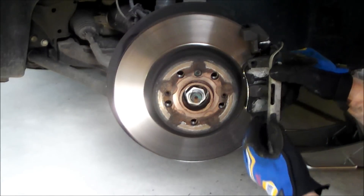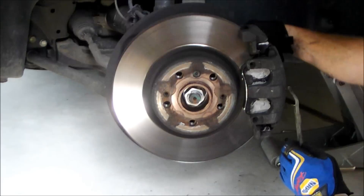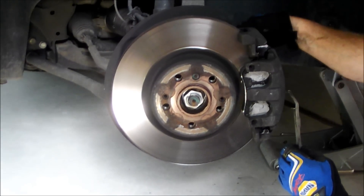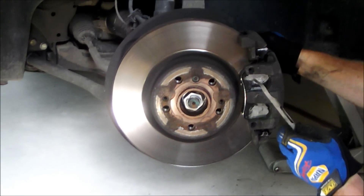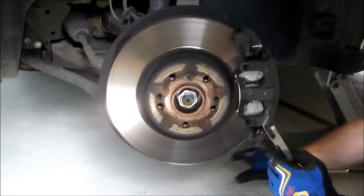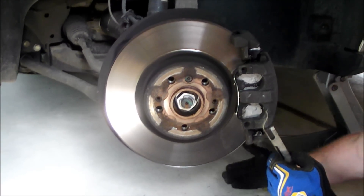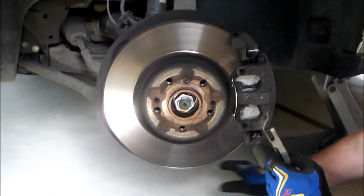The last thing you have to do is put the bolts in and tighten them up. Don't forget to put in these little protective caps — I put in a little anti-seize there as well. Also make sure to jack the car up and put safety stands under it. Never put yourself underneath this area just in case the car falls.